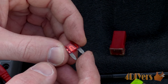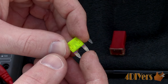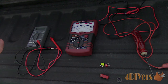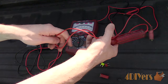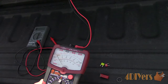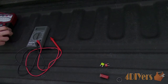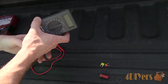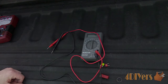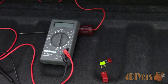Now for a continuity test — this can only be done with the fuses removed. When a meter is set to a continuity setting, this puts a small amount of voltage to the circuit you're testing to check for resistance. You can risk damaging an electrical component when it's still installed in your vehicle, which is why the fuse must be removed as a safety precaution. A test light can only be used if voltage is present, so this cannot be used here. I can use an analog multimeter, but it needs to have batteries for such a test and I don't have any installed, so I'll be using the digital multimeter instead. However, the same process applies to the analog multimeter — the only difference is the gauge readout. There are two ways to do this: using resistance or the continuity function.